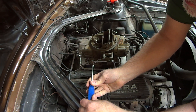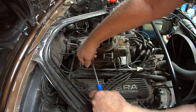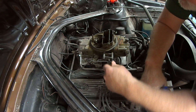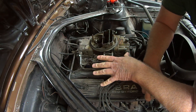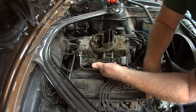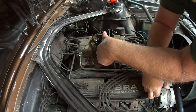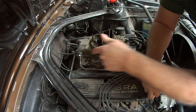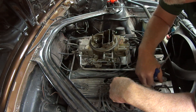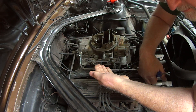What I want to do is start the motor up. If the motor is hot, I'm just going to pull this back a little bit. With it idling at the proper speed and everything adjusted — the idle mixture and everything — I set it so that the fast idle cam is just barely off. I don't want this screw on the fast idle cam holding the throttle open. I want the idle screw over here controlling the idle. I adjust that so I get maximum fast idle.